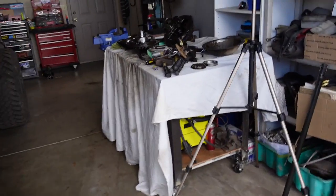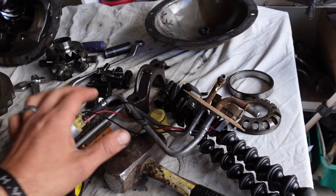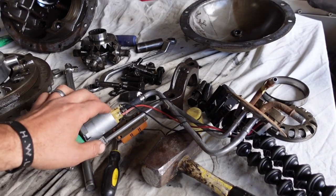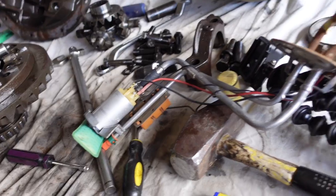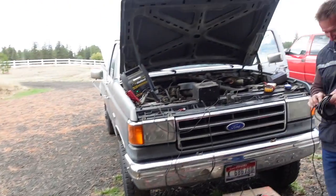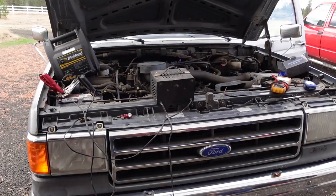She should run. And you can actually pull the front tank pump out without pulling the bed, which is great. We put power right to the pump and it's not turning on. So pretty easy fix. I'll just replace the front pump for now until we get ready to do that flatbed. And so, to be continued on Fordinand.